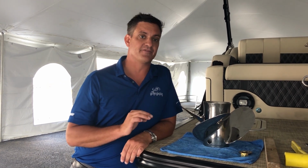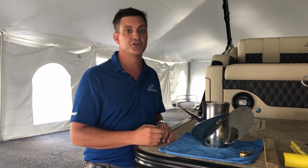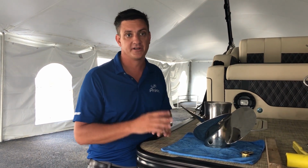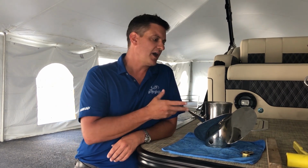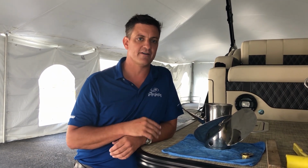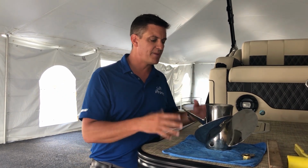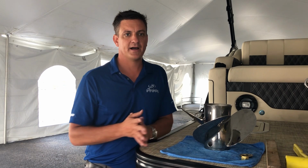And because it's not a perfect science, generally that would mean going to a dealer, maybe discussing a little bit about your needs, where you boat, your elevation, how you load the boat, and say, hey, we want to try a little higher pitch. I'd put one on, I'd give it a shot and see what it does. And you can talk to your dealer about that. They'll be an excellent resource for you, because we don't want to over rev boats, we don't want to under rev them. A lot of variables in play, but at the end of the day, that's what propellers are all about. That's why we measure them, and we hope you get out there on the water, have a great time.